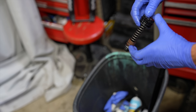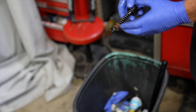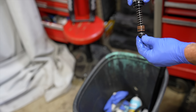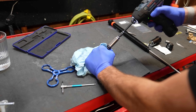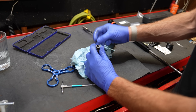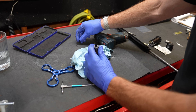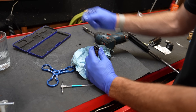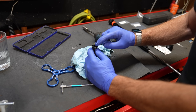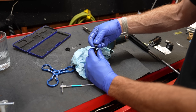Here's the compression assembly on the MRP Version 1 damper. We've got a really stiff spring here — all the new forks and good dampers have really stiff springs — not too different than the Fox or EXT fork I took apart recently. I probably shouldn't use impact guns on suspension, but it makes quick work of it. So here we go: we've got the retaining piece, then the face shim, and then here's the piston. Make sure we put this back on right — it's got a raised bevel — and this is what we're after: the red tune shims.